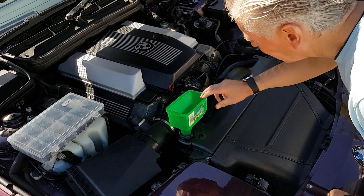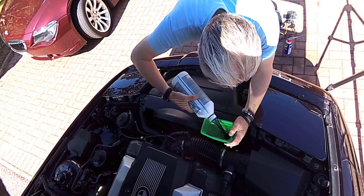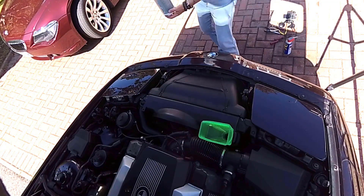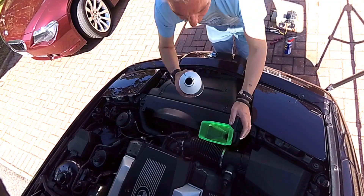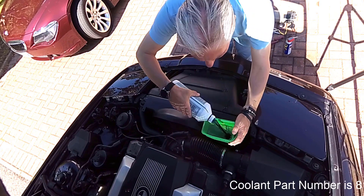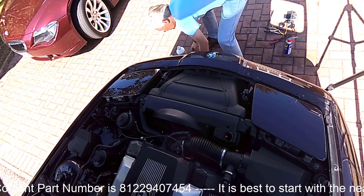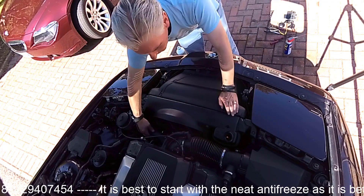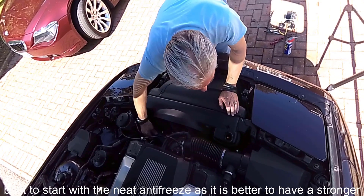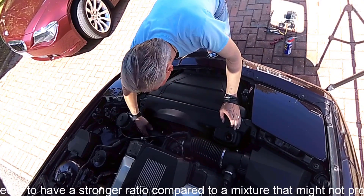Time to refill the system. I'm using BMW's antifreeze, which comes in one-and-a-half litre bottles for ten quid direct from BMW. Absolutely no point in using anything else — this has got plasticizers, anti-corrosion elements, and lubricants in it. The float is floating and the top hose is completely empty, which is quite normal for a drain of this size.